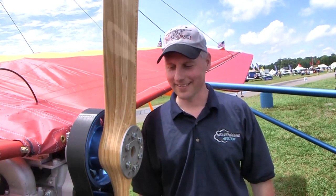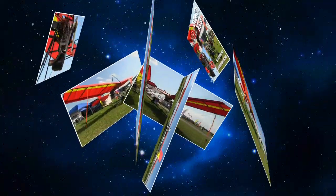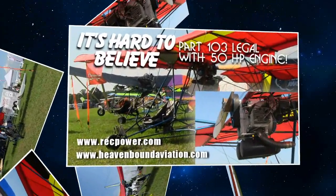How does this thing fly with 50 horsepower on a Part 103 airplane? It's incredible — heaven-bound! This airplane stalls at 16 mph indicated, and you can climb out at 16 miles an hour. The angle of climb is insane. Ground roll is about 25 feet in good conditions — we were off in 25 feet. Chris flew it today, a Quicksilver dealer, and he was afraid to give it full power — and he's flown forever. For a Part 103 aircraft, that's an amazing statement.